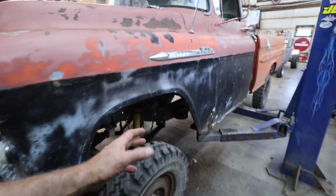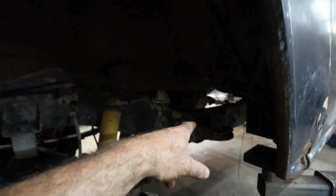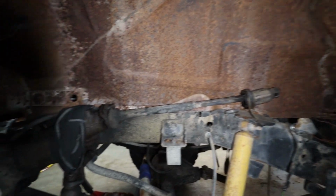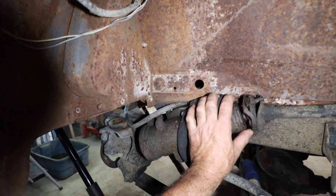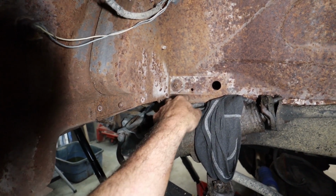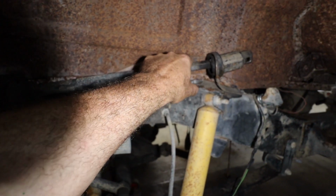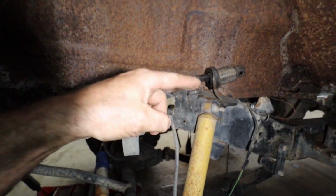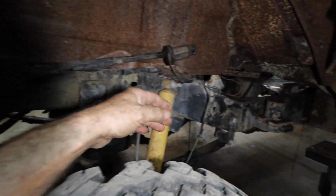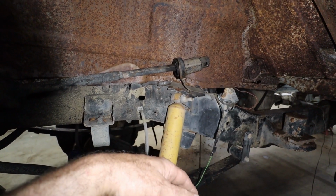So like I said, task at hand. I basically will probably lift the cab up. I'm going to cut these mounts off. Let's give you some light in here. And then in here, you can see it's touching the steering box and stuff. So the plan here is going to be, we'll probably trim. I'll trim into this section for now, because we're going to have to eventually get that steering arm on that side. And I think I can lower the cab about 2 inches or something, so that should help, I'm thinking.